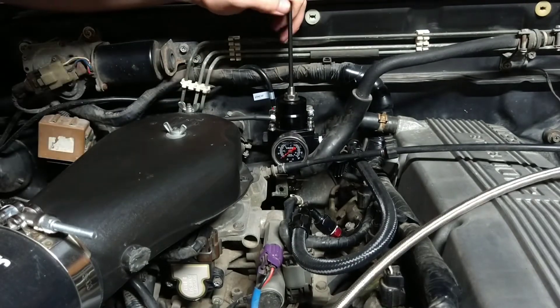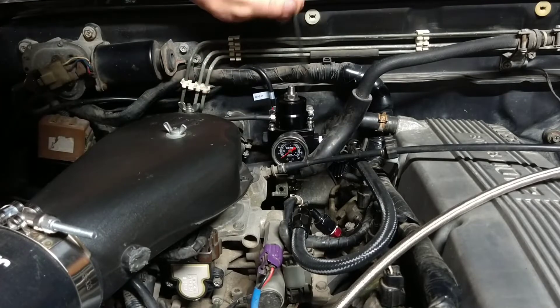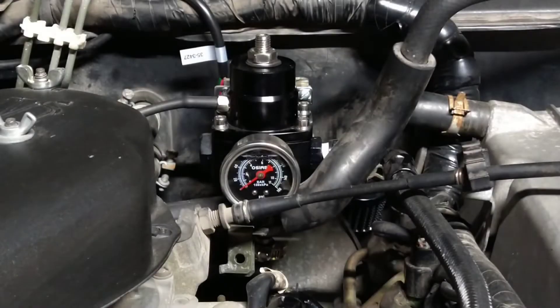Just kind of snug that down. You can actually see the o-ring come out around there, so I'm not real confident anymore, but we've come this far. I've got you guys zoomed in on the fuel pressure regulator. I'm going to fire the truck up and come over here to make adjustments and set the fuel pressure — I think it was around 60 before, which seems a little high, so maybe 50, 55, or 60, wherever it runs happy.